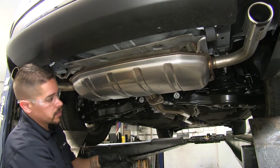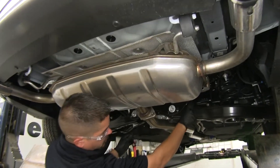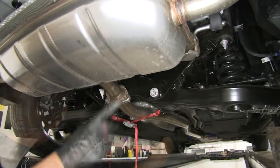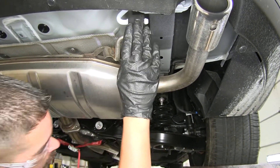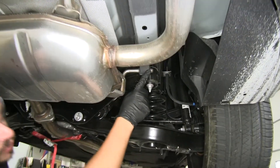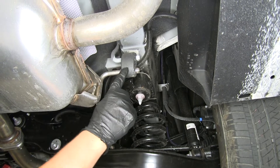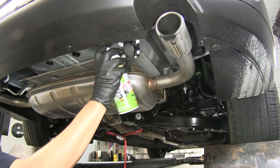We're going to have to lower our exhaust down, but before we do, you want to make sure you get some kind of strap to support it. Just find a secure spot to hook your strap onto. If we come towards the back by the tailpipe, we'll notice that we're going to have one hanger towards the center of our vehicle at the very back and another one right behind on the outside of the muffler. We're going to have two of these and also two in the same spot on the other side.